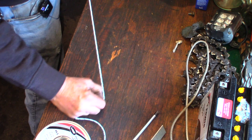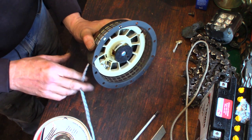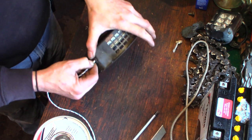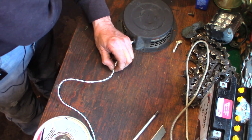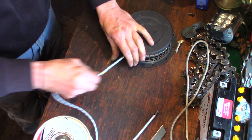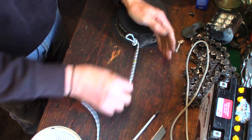That's quite a bit more cord in there — about four or five feet of cord now. The spring is completely relaxed, not pulling any tension, so I'm going to pull maybe five or six inches out and cut it there. That way the spring is still under tension so the handle will pull all the way up to the recoil and stay in position. Going to mark that with a paint marker so I know where to cut. Put a quick little knot back here to stop the recoil from pulling itself in while we're working on it.